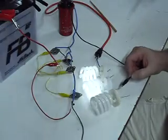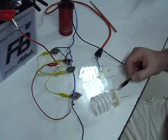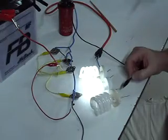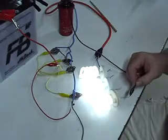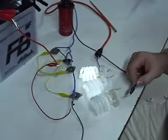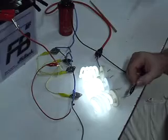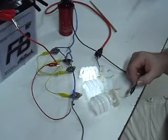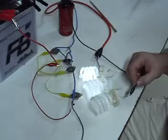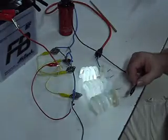Very, very small — just about touching — it is not even a half a millimeter spark. Touching full, with earth, bright light. Remove the earth, bring it away, get the spark flowing there, and we have a very strong light. Coming to the third light — connecting earth, disconnect the earth, that is the spark. Now when I have the spark, that is not enough. The further I bring it away, the more light. But there is a spot, as I am moving away, that it suddenly goes brighter. There is this little place where it just goes bright.